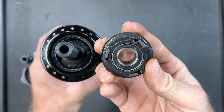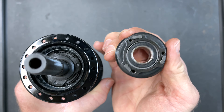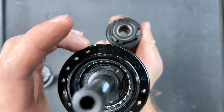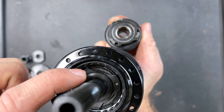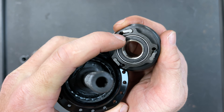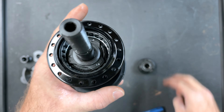If you imagine these pawls are springing downward — meaning they're trying to stay closed — when we rotate this hub it spins that wedge piece, and you can see the ramp there which goes upward. That ramp comes in contact with the pawl and lifts it up. So you might be wondering: what happens when that wedge lifts the pawl all the way up and gets to the end of where it can travel?